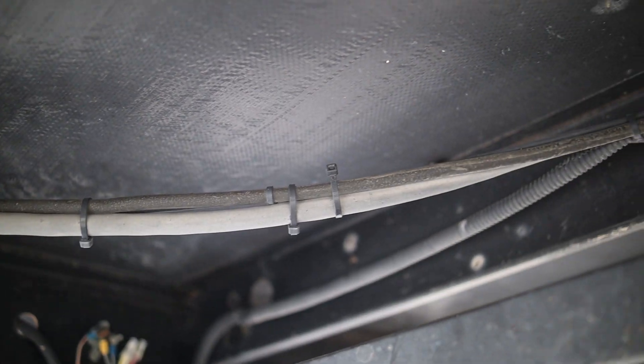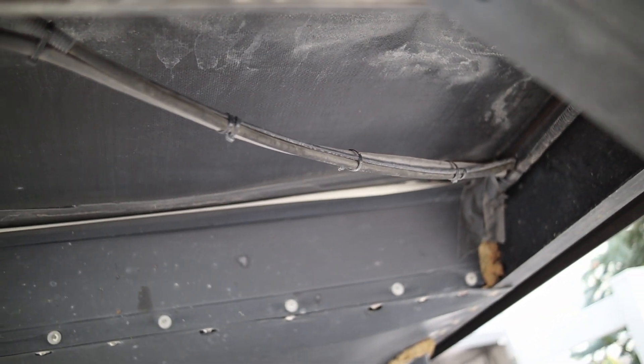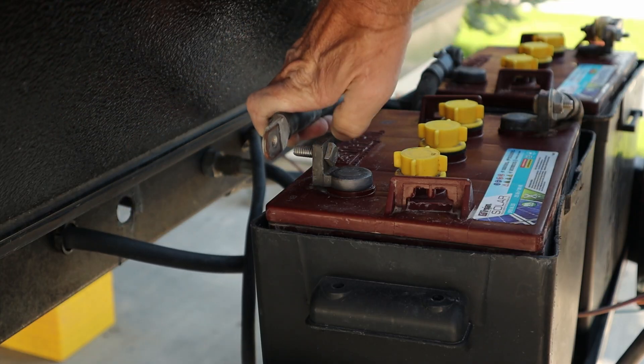The first thing I did was replace the six gauge wire that went from the battery terminals into the converter box, and that was about 20 feet worth of wire. I replaced that with two gauge, which ended up being welding wire. I replaced the connectors and I found a local battery shop who would crimp the end connectors on for me because I didn't want to buy the tools myself.